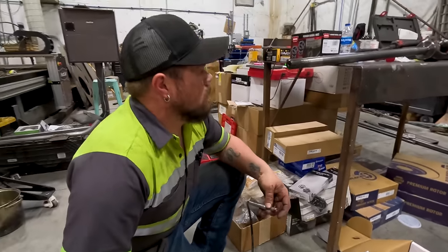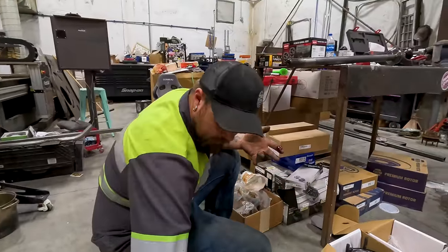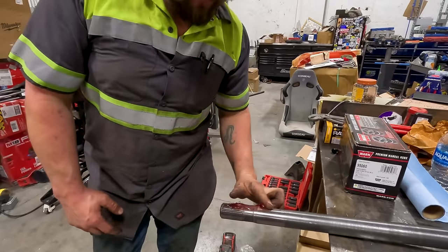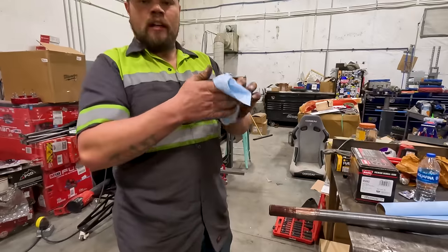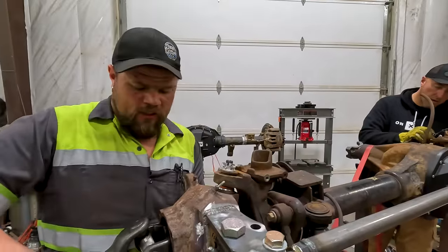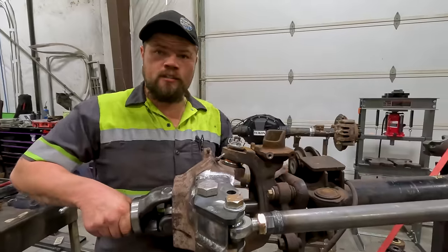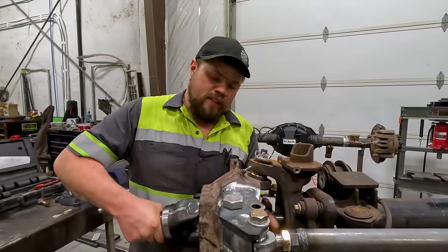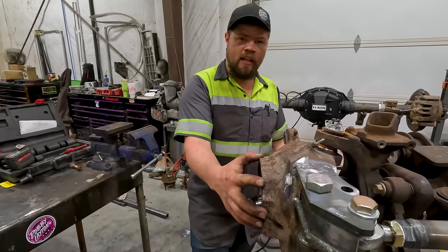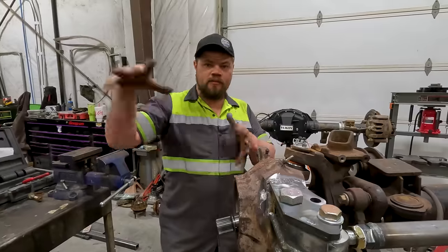Now that we've got the high-steer kit on, Colt's putting this side together and Hillbilly's going to put the axle together. We've got the new Yukon axle shafts — he's got to put the U-joint in and then slide it in. We went ahead and got new hub-bearing assemblies, new brakes, new rotors, new calipers, new everything. We've even got some Warn premium manual hubs, so this axle is literally going to be brand new for the bus. I've got my front axle shaft put together with the new U-joint and I'm getting some grease on the axle shaft so it helps the seal and doesn't tear when sliding in. You have to center the axle shaft, getting it lined up inside the hole for the seal.